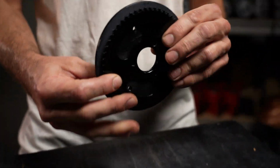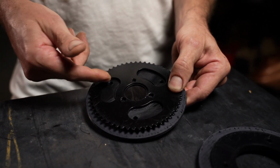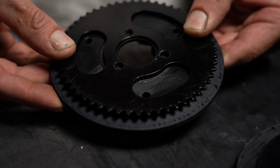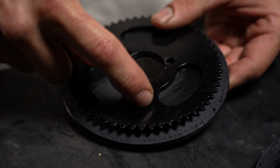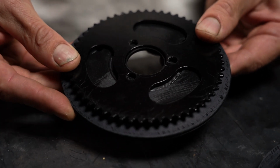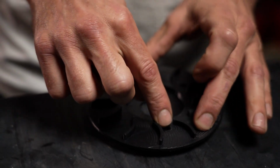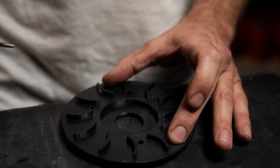One other thing to pay attention to is that if we drilled the holes where we have it laying right now, you would not attach this to the gear because the holes are in these oval openings on the existing gear. So when you drill them, you need to make sure you spin the gear to where you're actually drilling through some actual meat on the gear. What I've done here is I'm just showing you upside down that when you rotate it, the 3 holes end up on this surface right here. So now when I go to drill those holes, I know that where I marked these holes, they will be on a meaty surface for me to actually bolt up to.